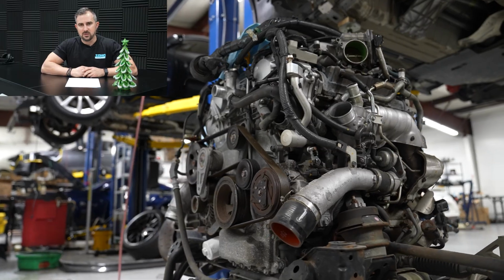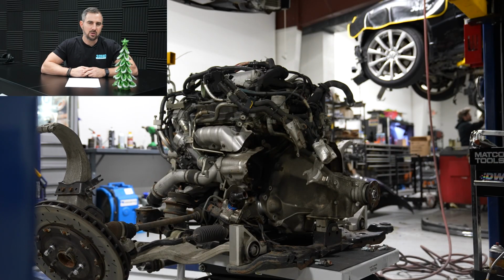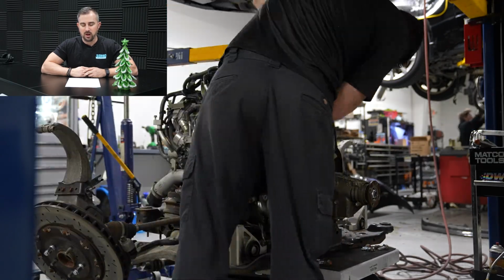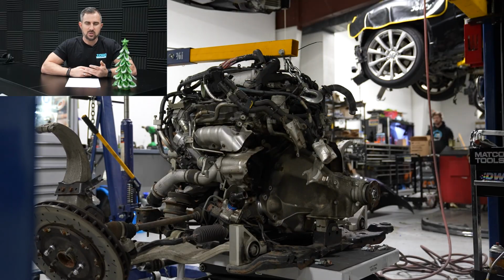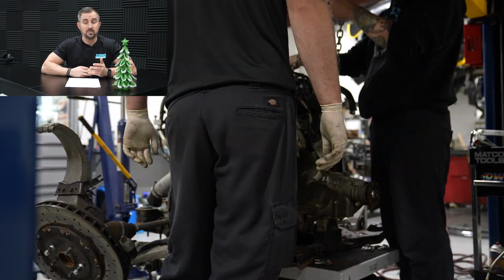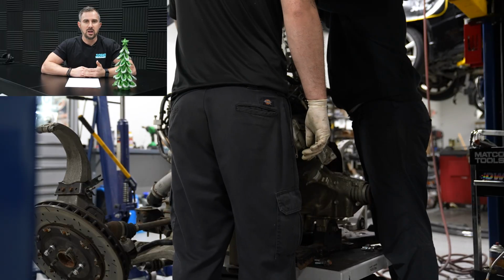Now, we put some E in this vehicle. We got the E content to around E50, and we bumped up the boost on the E content. Around 19 PSI, this vehicle put down 712 wheel horsepower and 641 foot-pounds of torque. So we were still able to keep the torque below the limit of the stock transmission, which is around the 650 foot-pounds of torque mark. Keeping it below that ensures the transmission is going to last. You have the top end power, you have the torque sustain.